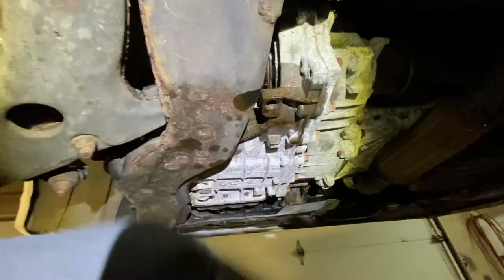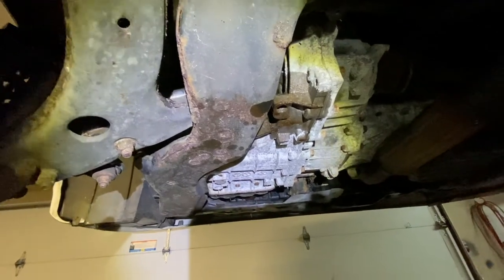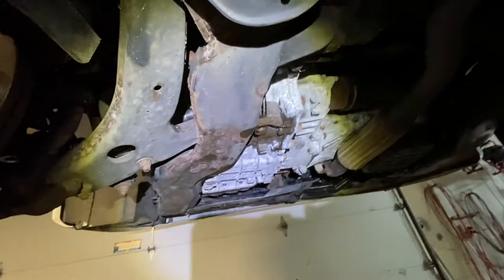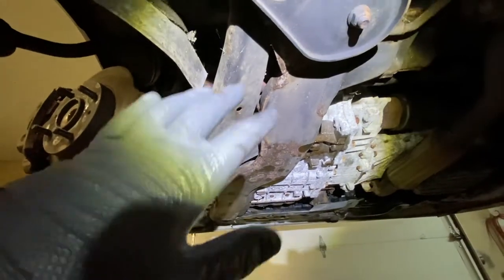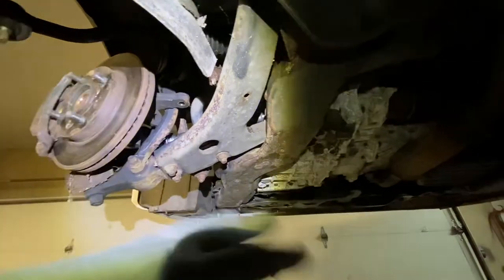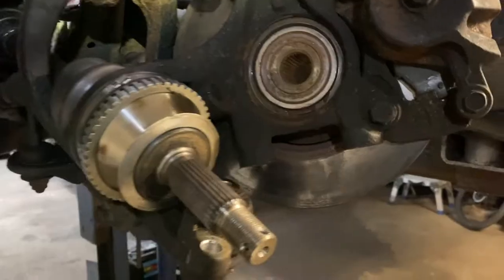Get some brake cleaner, spray all the areas, blow it off, and make sure it's dry. When you put the transmission fluid back in, check for leaks. A considerable amount of tranny fluid came out. Note: if you're on the floor the car is raised at an angle, so you may not get as much leakage as on a lift where the car is straight.